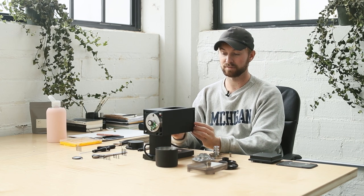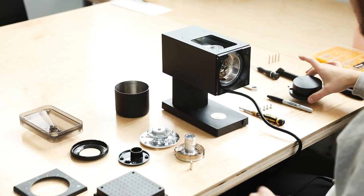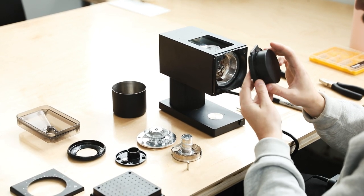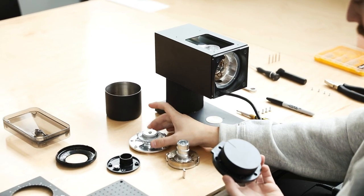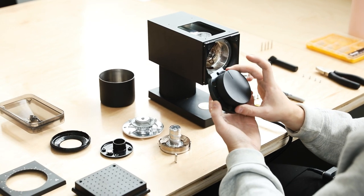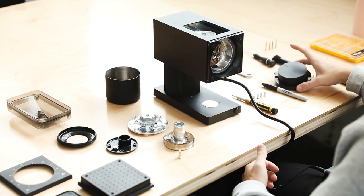This is cool - there's potential for you or Fellow to come out with something more specific, like a stepless version. You're able to customize this piece, which could create some personality for the grinder. Other than that you have the plastic piece here with the controls, which is attached to the step adjustment. When you go to put this back in, make sure you're lining it up with where you left it originally - make some markings so you don't put it in the wrong place.